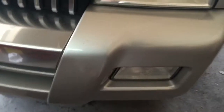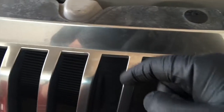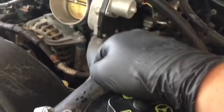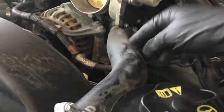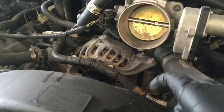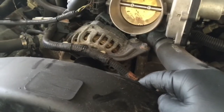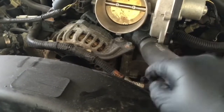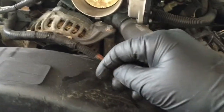While the bottom is draining, I've got both the cooling hose holes on the bottom draining and the two transmission lines on the bottom draining. Now I'm going to loosen this one up, take off this side, and take off the upper radiator hose. Then with a 10mm bolt I'm going to unscrew this one and move it out of the way, and take out the fan shroud. I'll see which one I need to remove first — the fan shroud or the clutch fan assembly — but we have to remove both to get the radiator out.